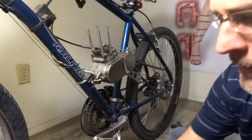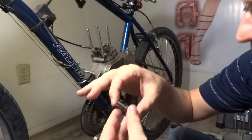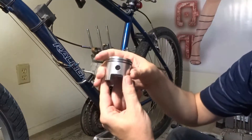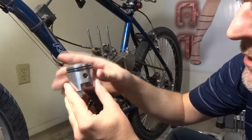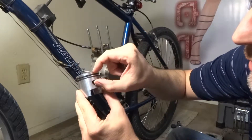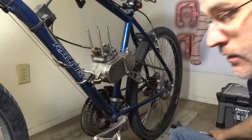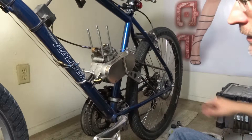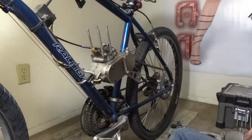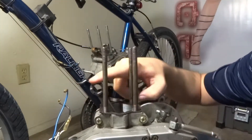In this video we're going to take this wrist pin and wrist pin bearing and put it back on my engine. I bought the right piston here — this is the smaller piston, which is 21 millimeters from the top to the center pin. That's the engine I had, and that goes with the long crank arm, which is this one here. The one I had before was a shorter crank arm, and that's what that looks like.